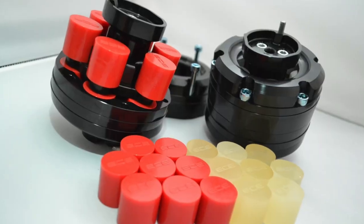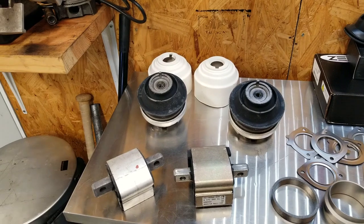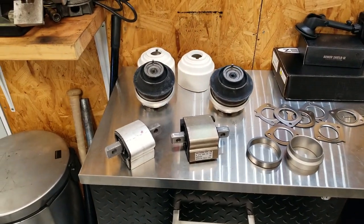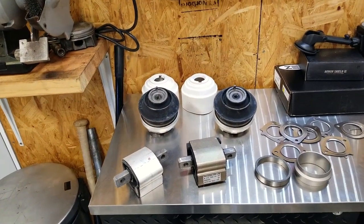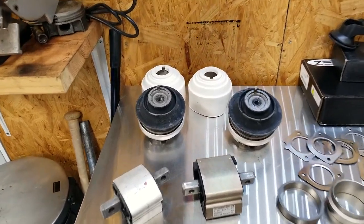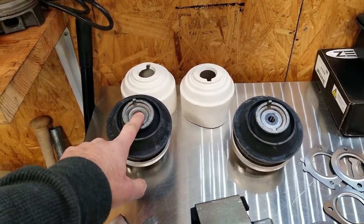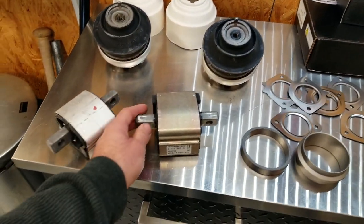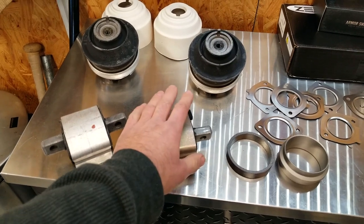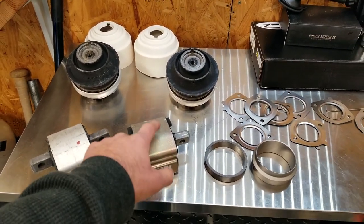You have awesome options: you can go with aftermarket polyurethane bushings that are very strong, although they will transfer a little bit of vibration into the cabin, which I do not want. I want to retain the factory isolation from the engine. So I went with a factory-style engine and transmission mount, but a subscriber told me that a really good option is using the engine and trans mounts out of the Black Series cars. I had Kyle over at FCP Euro do research, and he found that the engine mounts out of the Maybach fit the E55 — they're a lot beefier and stronger but still offer that factory-style isolation. I'm also trying the CLK Black Series transmission mount, which looks physically the same but is a lot more robust with much stiffer rubber inside.